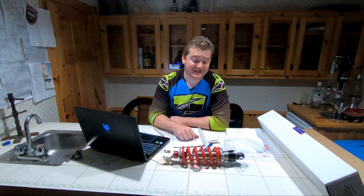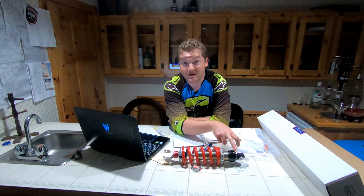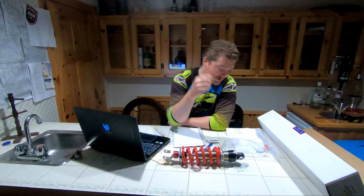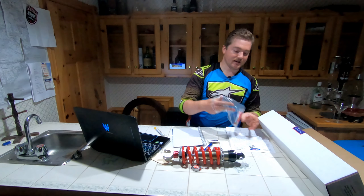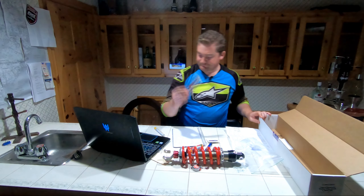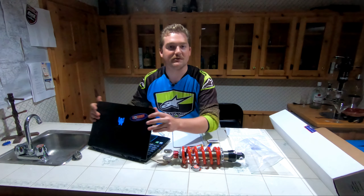Even with that, I still had one question: which way do I put this? Todd said as a general rule it goes forward, but it doesn't really matter that much. Whatever way your little knob on the stock shock is oriented — like the bit for the remote adjustable preload — if that's going towards the front, put this towards the front; if towards the back, put this towards the back. It also came with life savers, which is great because I just recovered from food poisoning. And lots of stickers — we'll just throw one of these on right now just cause I can. Now we look like one of those sponsored assholes.